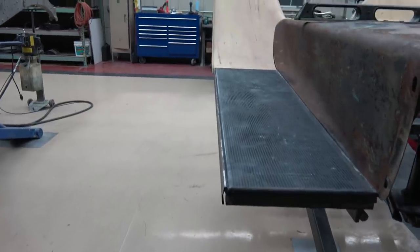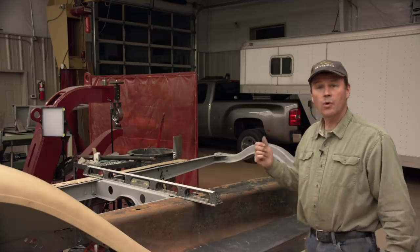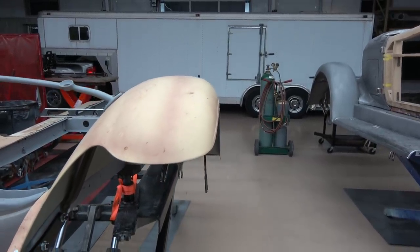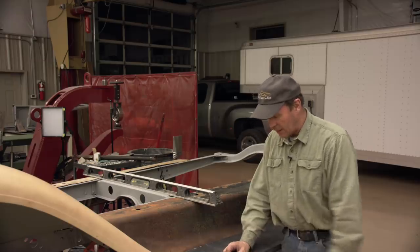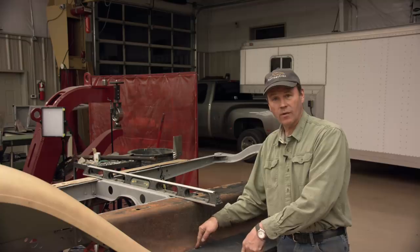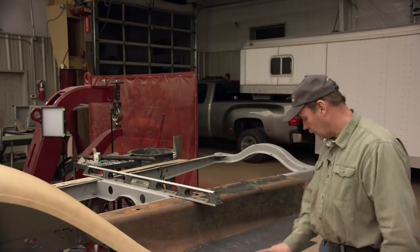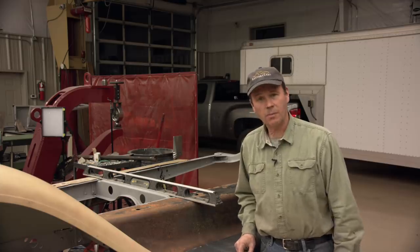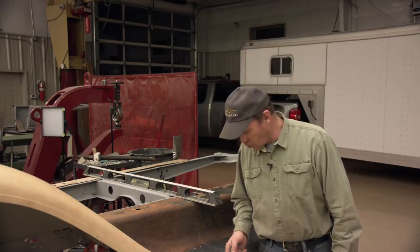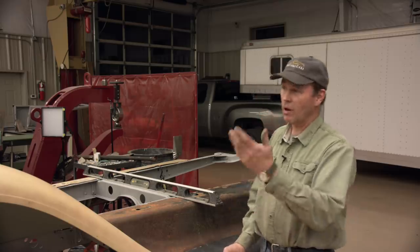Another thing I look for is this edge here. I want to make sure that the fender is straight all the way down here. When we get to putting the body on the rear fenders, I've got to have a nice straight line all the way down these fenders — no in and outs. We want this to line up just exactly right with the zinc trim. This is just sticking out just a hair because I've got to put the zinc trim back on — I had to take it off to get a true reading of the level. One little note about these running boards is that they're like $500 and some bucks. I wish they would not install the zinc trim. We always have to pull it back off and notch the little corner around this round bead here like they did originally. And pulling them off is harder than putting them back on again. I don't know why they just don't leave them off.